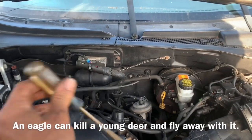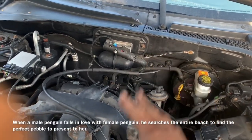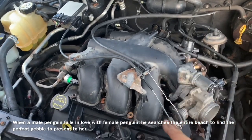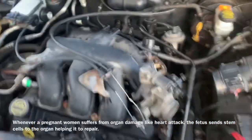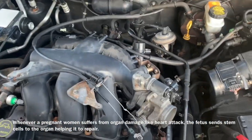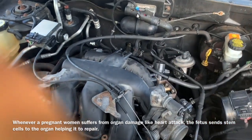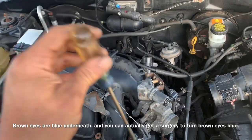What you can do is hop in the car — even with the intake off — and with your coils disconnected and fuel pump relay unplugged if you're concerned, just bump the key a couple of times: bink, bink. Step out, stick the screwdriver in there, and make sure the piston's not up. Bump it once, check it — if it's not fully down, bump it again. What this does is it closes the valves inside the engine.